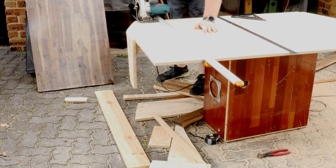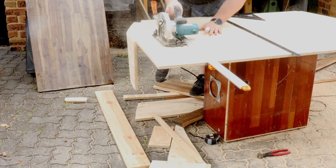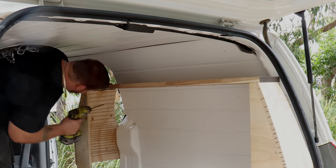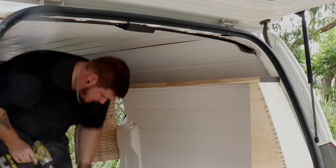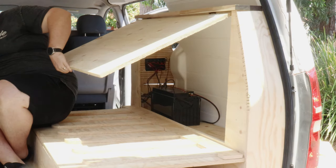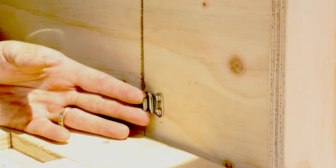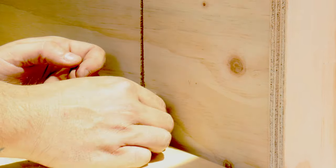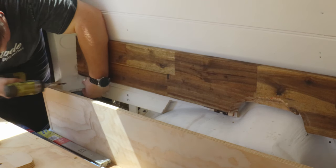Off camera, I built a new backrest and moved the bed before reinstalling the backrest. I cut out the door in front of it and installed the backrest the same way. The hardwood is now one complete piece, locking the top of the backrest in place since it's no longer hinged — the door on the front of the headboard hinges instead. I installed the door with two hinges into the bottom of the hardwood top. On the bottom of the door, I installed a latch on each side to stop it swinging open while driving. Using a forstner bit, I drilled a hole in the center of the door at the bottom as a door pull. I also cut a new hardwood panel for the footrest and installed it to the wall with hinges, with the corner near the rear door attached separately so the top can still lift.